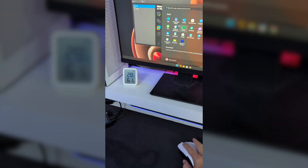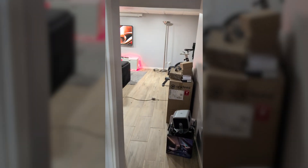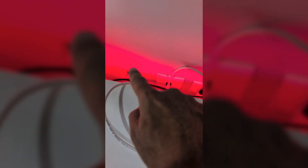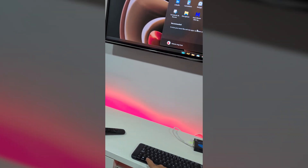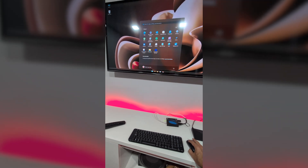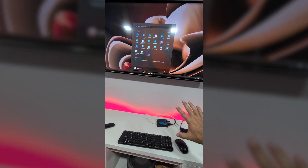We can connect more than one unit. Over at this third setup, I have another receiver unit with an Ethernet cable coming from my wall, connected to that same single switch, plus power and a USB dongle for keyboard and mouse. If I press the Windows button here or use the mouse, anything I do here reflects on the main computer. We are controlling the main computer using the KVM and HDMI over IP Ethernet, with a switch in the middle.